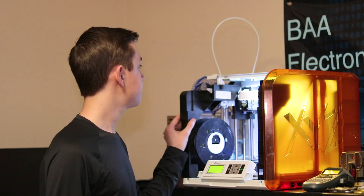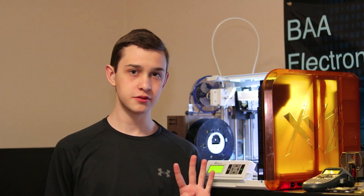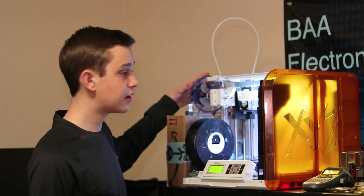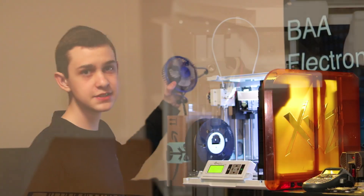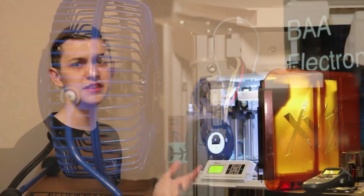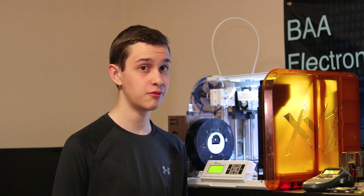One of the things you'll definitely have to maintain is the filament feeder. The filament feeder is held in by four screws, and in my experience, this feeder will chew up the filament quite often. A quick solution I've found is a small desk fan placed directly behind the stepper motor of the feeder. This is because the stepper motor gets extremely hot while in use, especially for long prints. Putting a fan on it may help it cool down to prevent melting the filament to the feeder gears, and in my experience this worked very well.